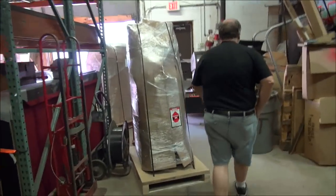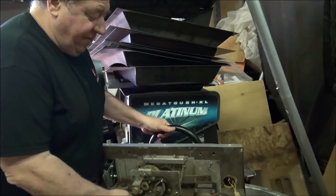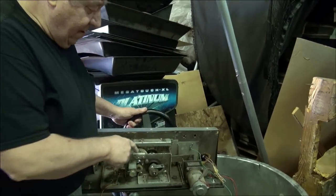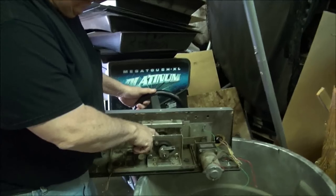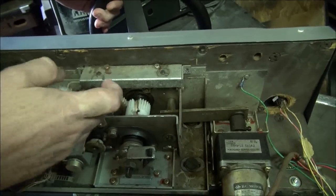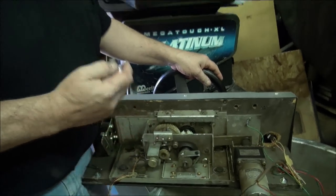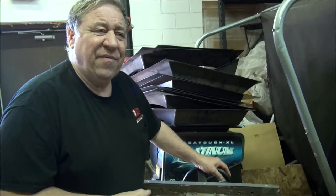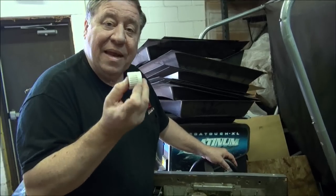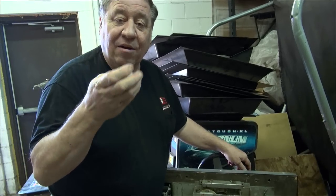Anyway, I wanted to show you something that we did with that OUTRUN that I forgot. All OUTRUNs in the world have a weak link, and that is the steering gear. They crack. See, inside the gear, there's a brass piece. Now, a few years ago, maybe 5 or 6, a collector who loved the game very much engineered a metal gear. So we have put a new metal gear, this gear.